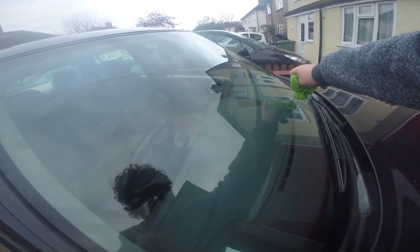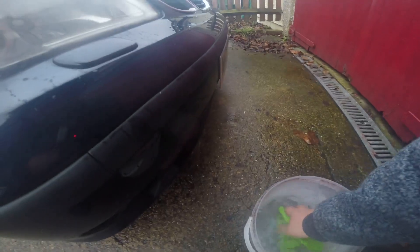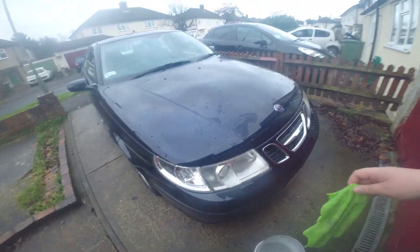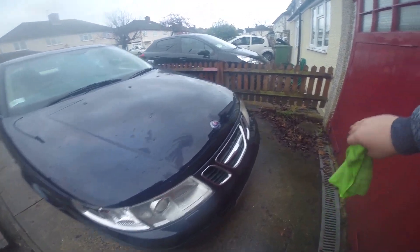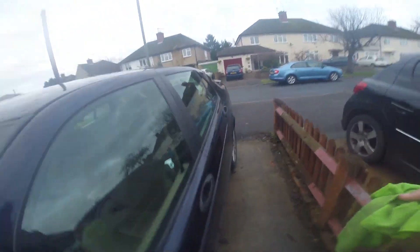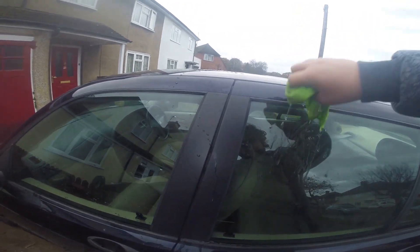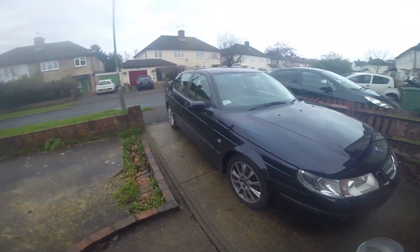There's some more on my glass — I'm gonna grab this last bit. Drip the water on there, squeeze the cloth, then wipe it off. It should come off with no problems. Problems arise if you leave it a while. Bird poo has acids in it — that's why it's bad to leave on your paint.